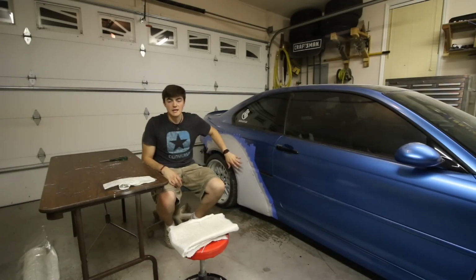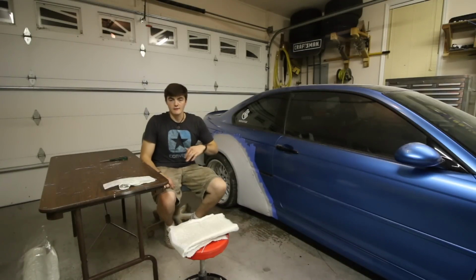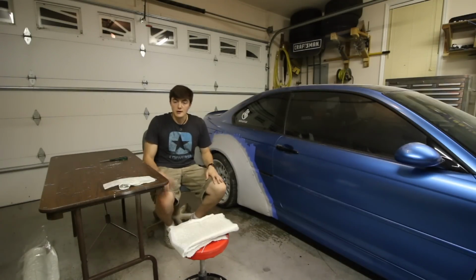So I'm going to do all my pre-cuts for my fiberglass, and then spray it with PVA, and go through the same mold making process of gel coat and then fiberglass resin, let it cure, and then pull it off. So it should be super easy. I'm gonna go ahead and get all my pre-cuts done.